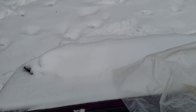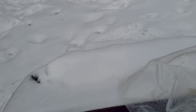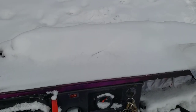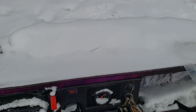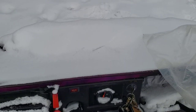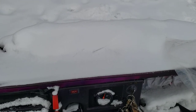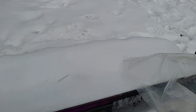There we go, back on the idle a little bit. This thing when it's cold always jumps up really, really high on oil pressure, and the oil pressure always backs off to about 40 pounds or so. Let's try and get an engine shot.